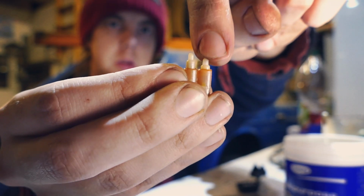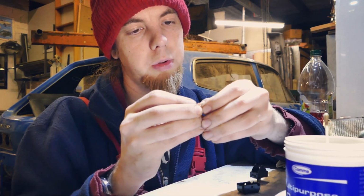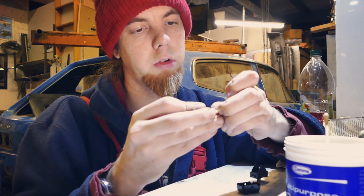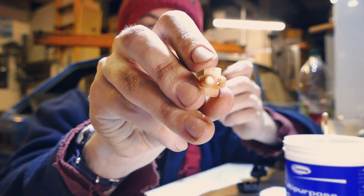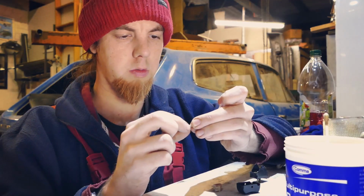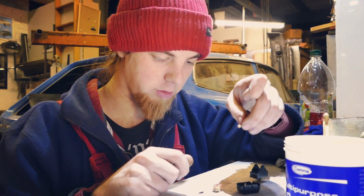This one, however, got hardly any spring on it. So I'm now going to very carefully pull that out. Again, not using pliers, too strong. You don't get any feel for it. Oop, there we go. So now that, firstly, it's incredibly mucky on the inside, there's loads of rust particles and things, and the spring is basically the same. Very rusty. So we are simply going to wiggle that about. Oh no. See, now I've broken it, because some of the spring is left in there and I have pulled the spring out.